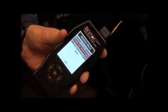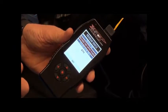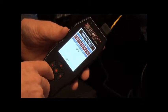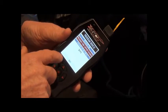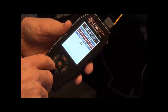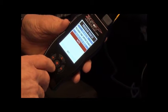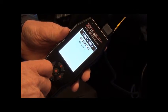Right, now it's going to give us the choice. And this is a little bit different in different model cars and depending what version of firmware is on that flash tuner. But this is just going to give you a general idea of how to walk through. Now, it does bring up a few options here. And as you'll see, this car here actually only has one tune loaded in the flash tuner. This is my own personal car, 16 PSI in there. So we'll just select down to the 16 PSI and then we'll press select.